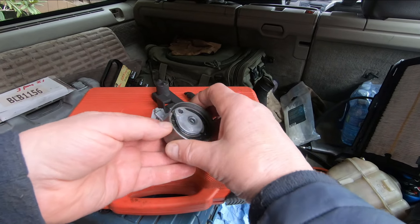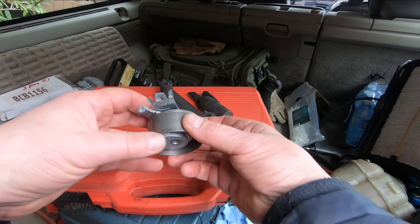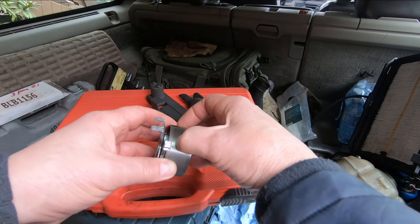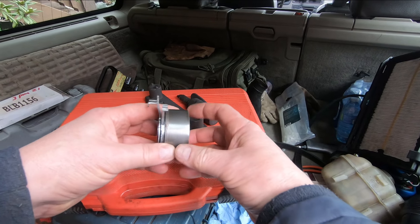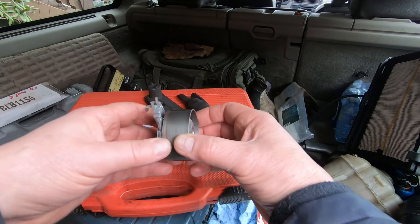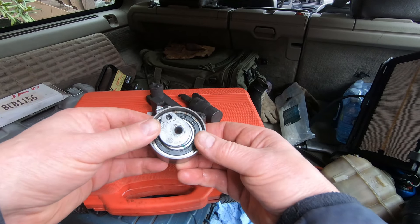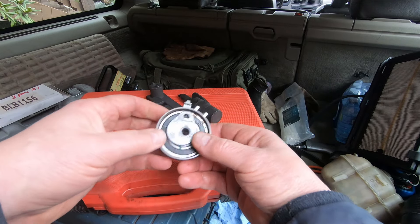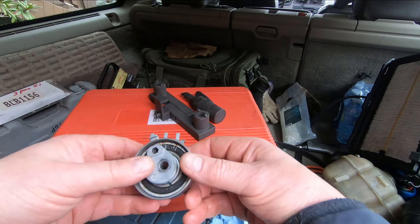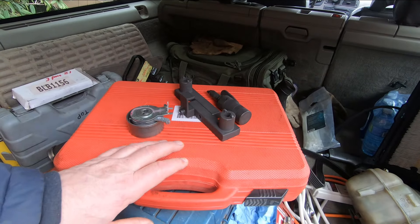What I'm doing today is not a complete timing belt change. The belt was changed about eight months ago — at that point I changed the water pump, belt, tensioner, and idler, a whole kit. But I was noticing the timing belt was tracking a little bit to the outside. You can see the mark on the tensioner where it was tracking — it was running on the outside, pretty close to the edge of the cam gear. I read that sometimes it's the tensioner, so I'm just changing the tensioner. I bought a new one; all the rest of the components are only six or seven months old.